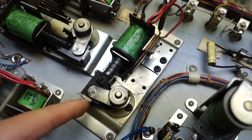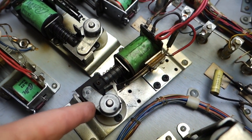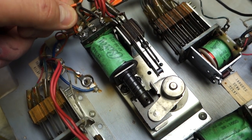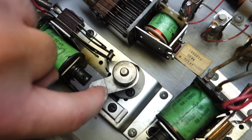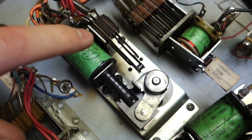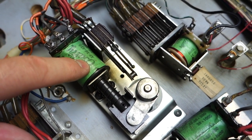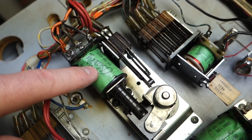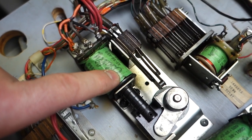And I gotta rebuild. We're gonna rebuild one flipper. I don't need to go through and do every single flipper with you, but this is probably the one we might be rebuilding. This is the one they sprayed oil in, it was rusted or stuck or something. I have a new coil for it. This one is soaked in oil and it stinks. I do not want that oil smell in the game anymore. Plus, it's got oil in it. Electricity passes through it. Easier to catch fire.